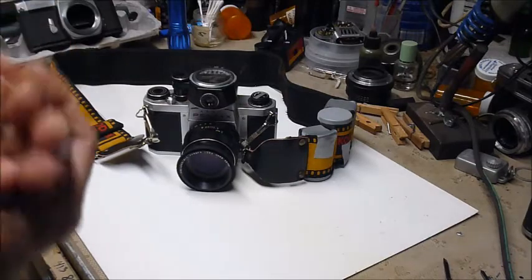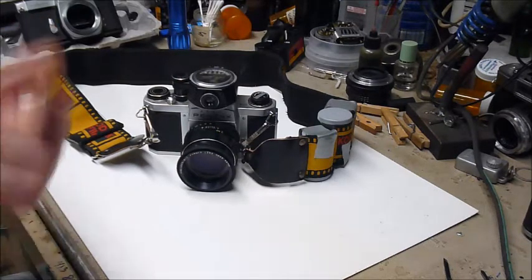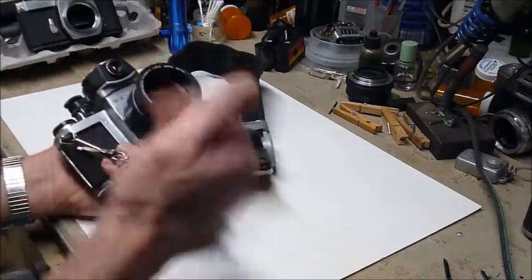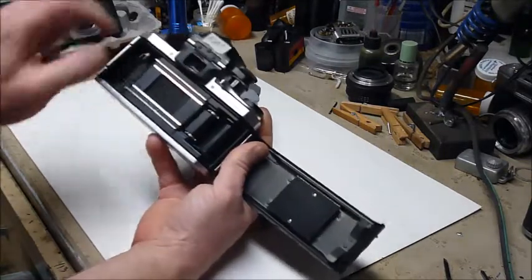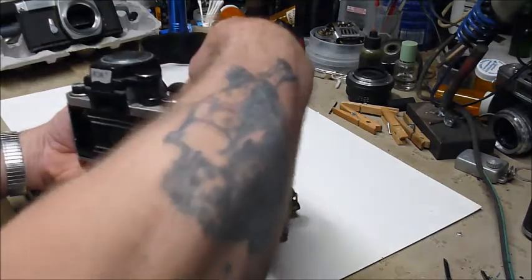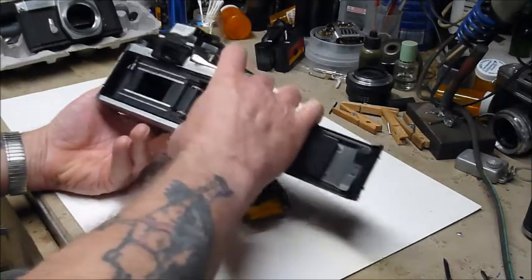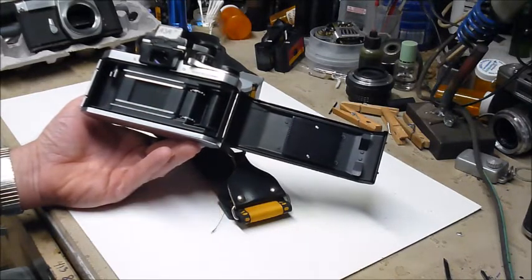I got cut off — I ran out of memory. Imagine a digital anything that runs out of memory. Anyway, I was only going to show a couple more images and they're all pretty much the same — mundane stuff, good overall image quality, just with that shadow along the edge. What that tells me: first of all, my handmade shutter installed in this camera works, in spite of the ripple in it. The only observation from image quality is that the shutter appears to be slamming shut a lot faster than it's opening.